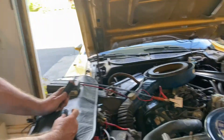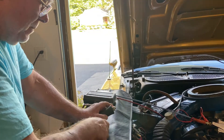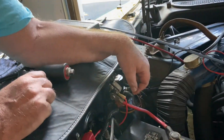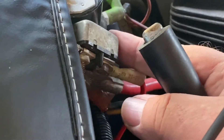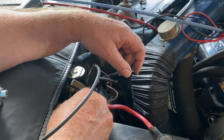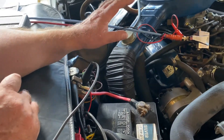I'm going to hook up what's called a remote start button. The idea is that when I want to crank the engine over I hit this button and the engine will crank. On a Ford, if I have the ignition turned off, the primary ignition will be sent battery voltage through this ignition wire. I'm going to put this clip over so it hits the nut on the terminal for the I terminal, so that as I'm spinning the engine over it will send full battery voltage through the primary ignition circuit into the distributor. When I connect this to the positive side of the battery and tell it to crank over, it'll crank over, but even though it's going to try to start, it won't.